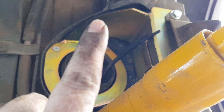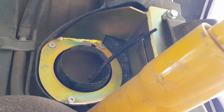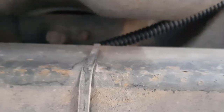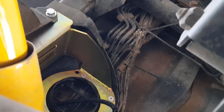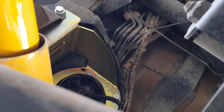So you can see I've run the air lines now. I've got them sitting through the spring mount just there. You can also see the BOSS 4x4 brace kit in there, which looks fantastic. I can actually just follow the line through here, going around the fuel tank and over top of the tow bar, and as you can see it comes out here. The other one goes through in basically the exact same fashion through to the spring mount. Now, as the instructions say, I need to connect up the airbags and lines, pressure test them to make sure there are no leaks, then put everything back together.